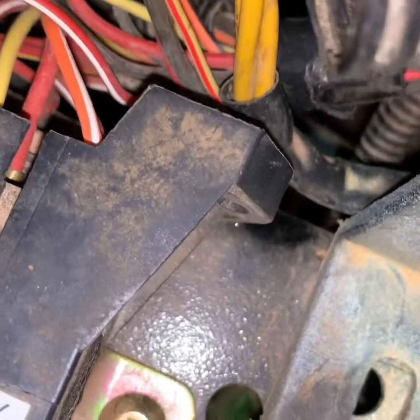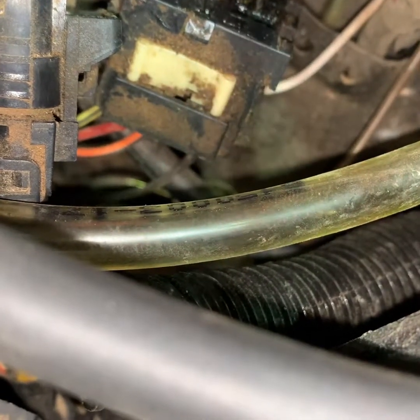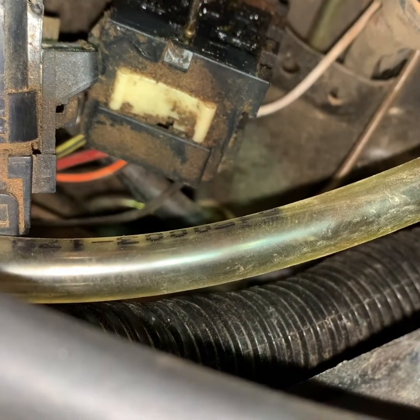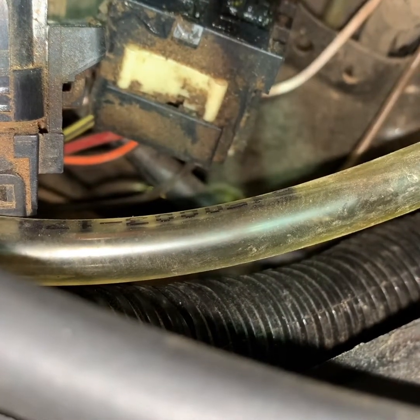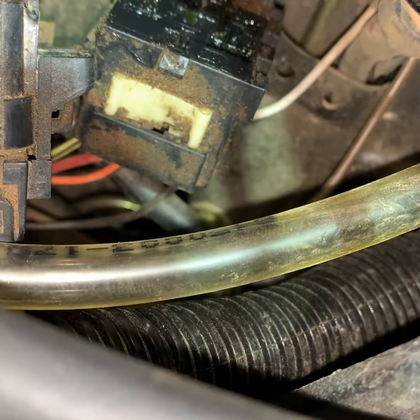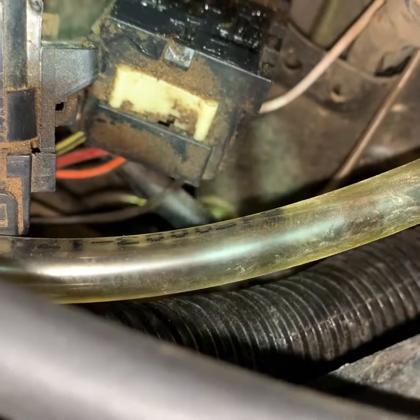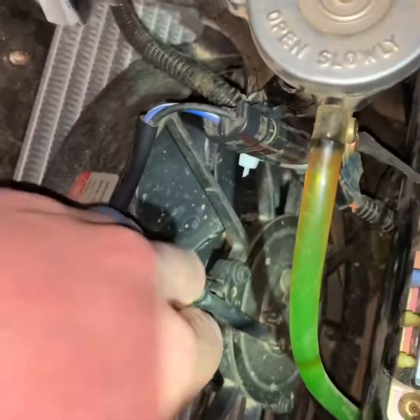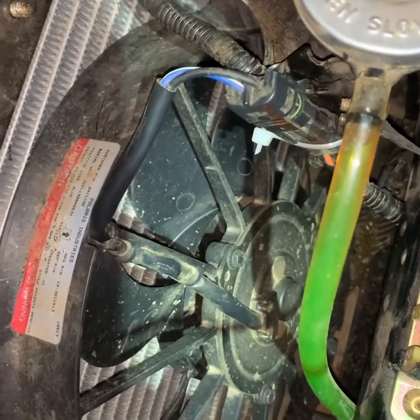You also want to check for unwanted grounds on your wires. Your right side is your negative — you will have a ground there and that is correct. Your left side is your temperature sensor — you should not have a ground there. The front side is your circuit breaker or power in and you should not have ground there. The back one is your fan, and on my meter it does read a ground there — but fans are a little different, so you should read a ground, but once you spin the fan it should change. With the power off, you spin the fan and the ohms change inside the motor.